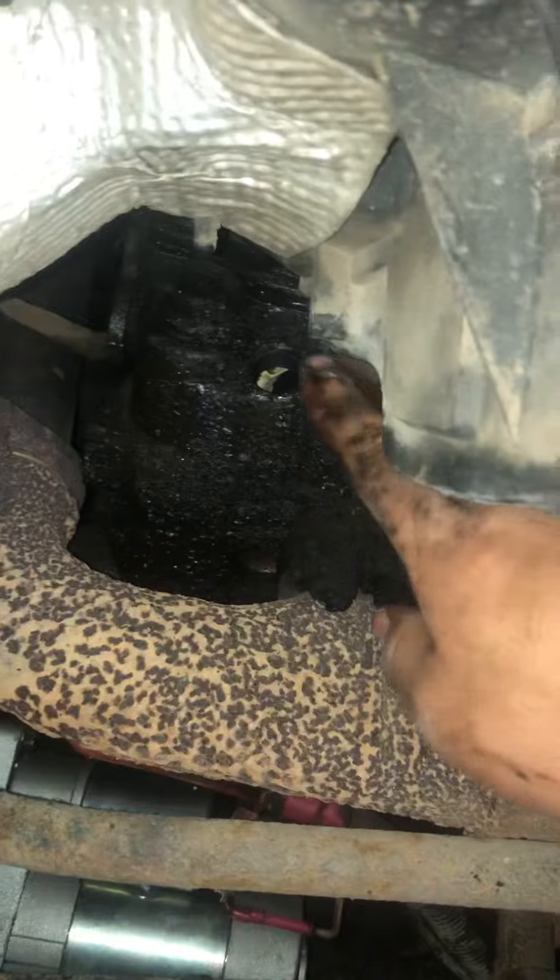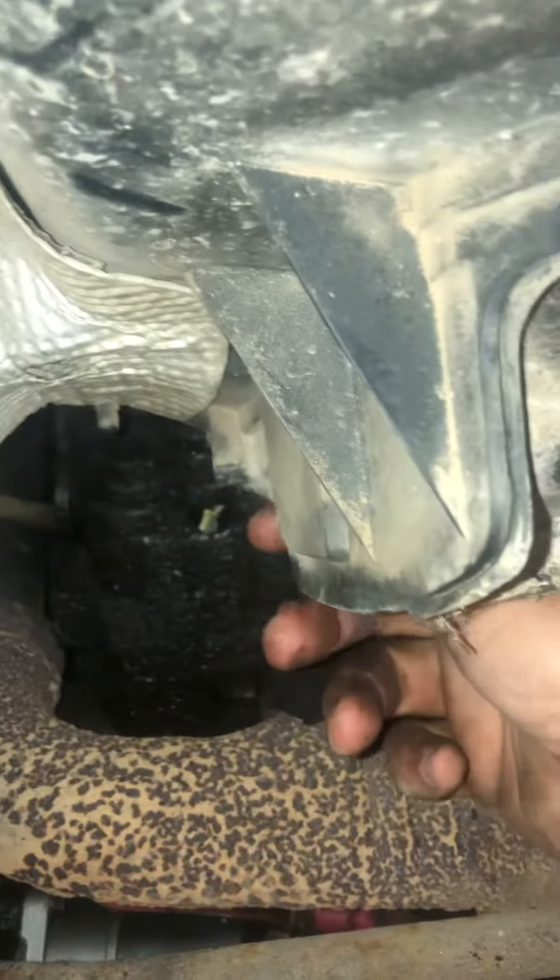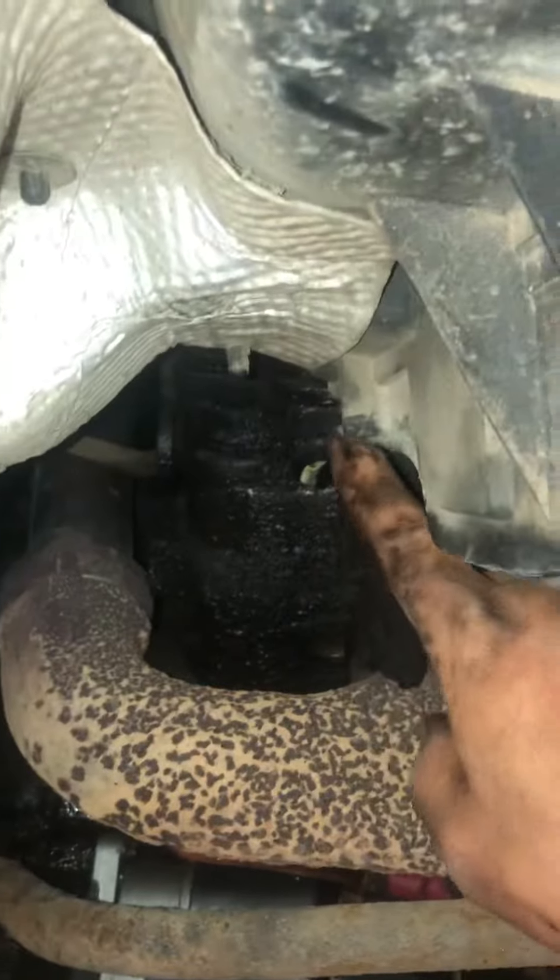I found this handy little tool where you can put a hacksaw blade in — that's what I used to cut that little flap out. Now for your rail, you've got to be gentle. Pull up a little bit here, move this way, wiggle it, pull it up a little bit — you should be gently able to slowly pull it down and out. You might have to come down from inside the fender well and climb up into the engine bay again, but it'll happen.